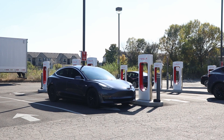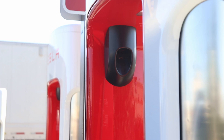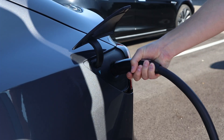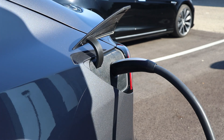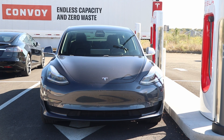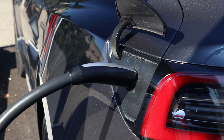When you arrive at the station, pull into an open stall. Keep in mind that the charging port is on the back left — the driver's side of the vehicle in the U.S. When you back in, get out of the vehicle, go over to the stall, pull the handle off of the holster, and click the button on the charging cable. That will open up the charge port on the vehicle, and then you can plug in from there. As soon as you plug in, your car will recognize it's plugged in and the Tesla network will as well — they'll do that handshake and immediately start charging. The charging station and the vehicle will negotiate and determine how much power the vehicle needs, handling the entire charging session automatically.